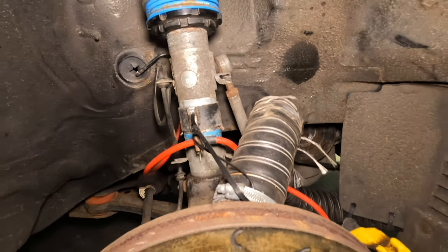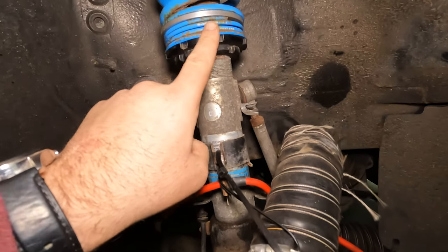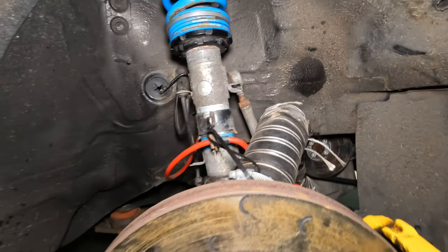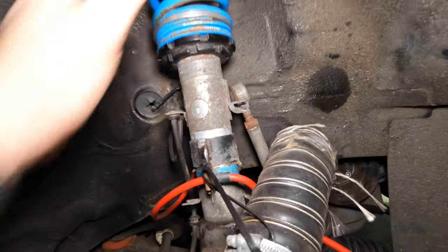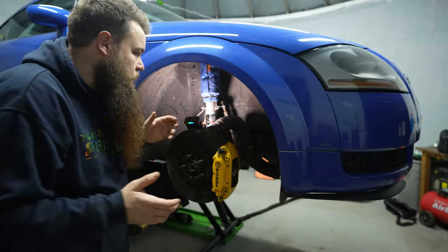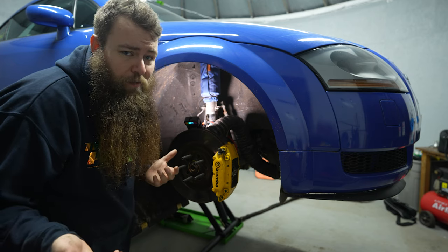Test fit your wheels. Now I've already done that just to make sure the wheels didn't hit the brake ducting, because if you go too low, that would actually hit the back of my wheel. So definitely, definitely worth test fitting one before you go around and swap everything else on the car. I'm gonna go around and do the other side now, and then I'll show you the coilover socks. Hopefully we'll be ready to get it down on the ground before we do the back, and we'll see how it looks. I thought I would finish doing the last little bit of this on the ramp, because I've got it so I may as well use it.